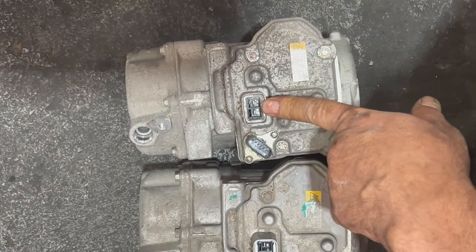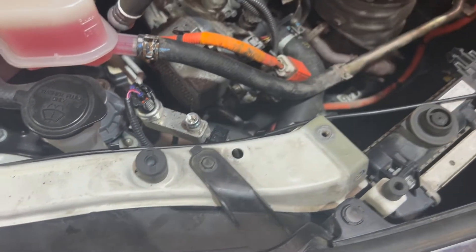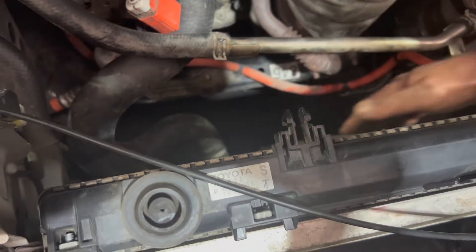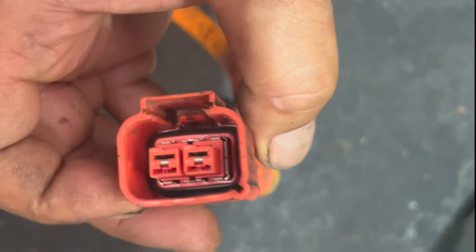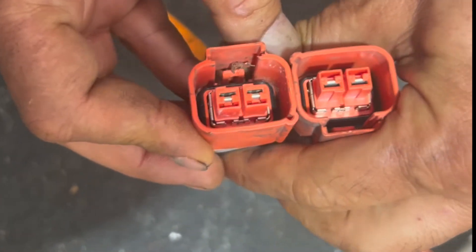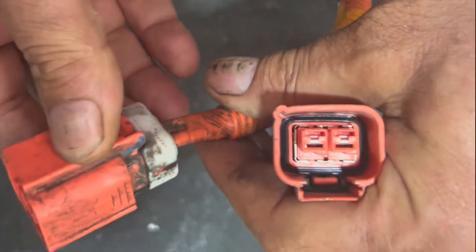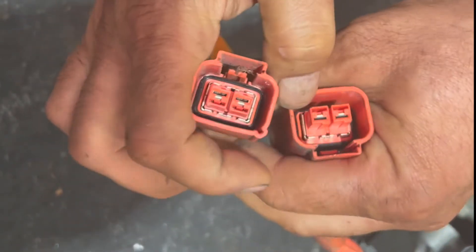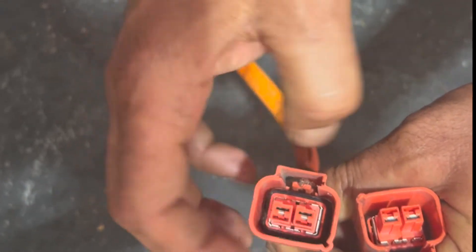In this condition you must change the wire as well. I'm going to put the replacement compressor in now. Taking this clip off — one clip here, one clip here and one clip on the back side. That's the new one from the wreckers. I'm not going to take the risk because I can't clean the old one — I don't have time to open it up, clean it, and put it back. If any carbon or corrosion due to water is still there it's going to give you the same code. So I'm going to use this one — it's a used one, but it's in better condition.